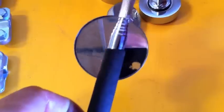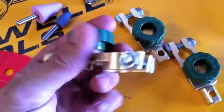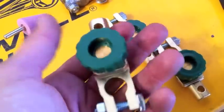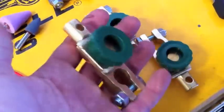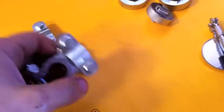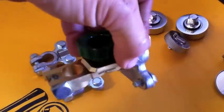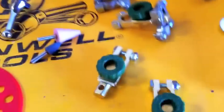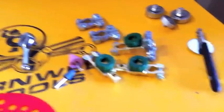We've got mirrors so we can track down and find parts that might have fallen down. These battery disconnect devices are really nice - you just turn the dial a little bit and it disconnects the battery from the entire car. A lot of Mustangs still have bad grounds or wires, and if the car sits for two weeks the battery can go dead. Simply turn this dial and it disconnects - that's pretty cool. This is what connects to the battery cable. We bought about three of these setups, so for future cars if anybody wants to do that with their Mustang, I recommend it.